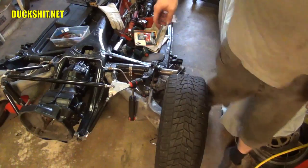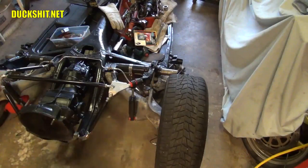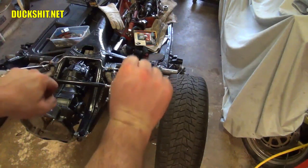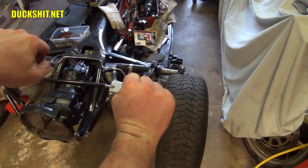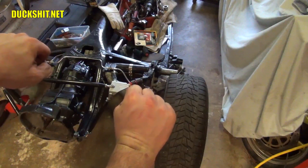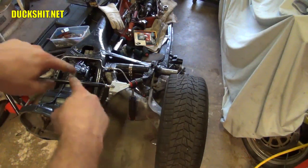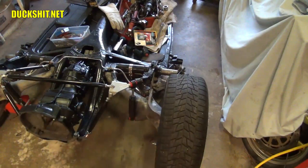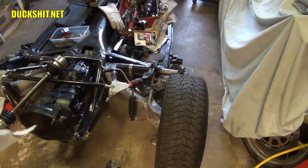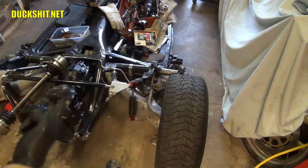As you probably noticed, I jacked it up. The reason for jacking it up is because the two CV joint drive flanges, when they're in line, are closer together, so the axle may not fit between the two. But when you move them apart a little bit, it's easier to drop the axle in between. Let me demonstrate. Almost forgot to do this. And you don't need a whole lot, two fingers' worth, just like that.